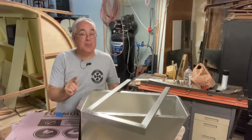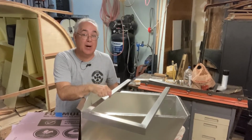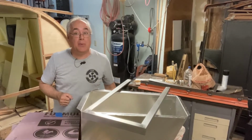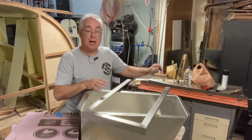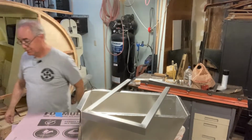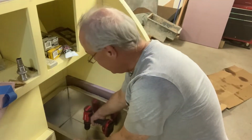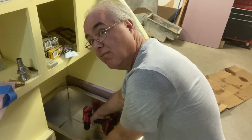Ooh, this will be scary because we're gonna cut a hole through the bottom of our new icebox, cut a hole through our brand new linoleum and redwood floor, and hopefully we'll miss the frame of the trailer. All right, let's take these pieces off. Let's get to cutting the holes for the drain. Now we're gonna drill our hole through the icebox, through the floor. We've gone ahead and marked where our framing is, so we should be able to miss it.